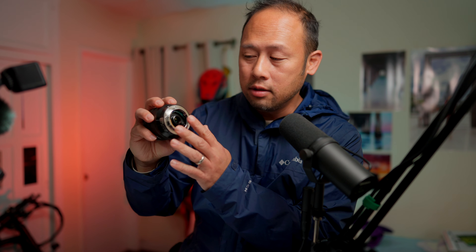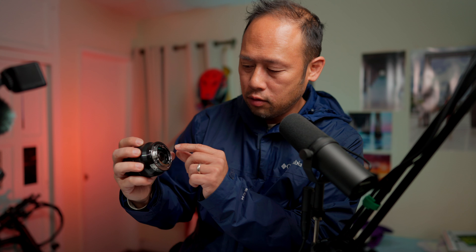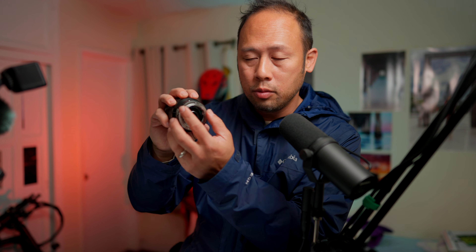That's all I've got for this little video where I removed the baffle. So if you see me referencing baffle removal, this is the most difficult one. The Sony 10-18 is the easiest one — all you do is just remove it right from the top. You don't have to remove the lens mount. There are three screws, you can see them here — one, two, three — and you just remove the baffle with those three external screws. The 10-20 is more difficult: you have to remove the lens mount and then reveal the clips which remove the baffle. But if you want to micro-size your kit or get that extra active stabilization, it might be worth it. Anyway, that's all I've got — hope you guys enjoyed it. Be sure to like, subscribe, share. See you in the next one. Take care.